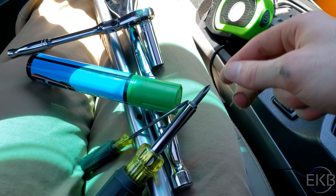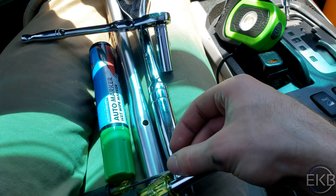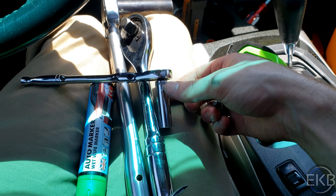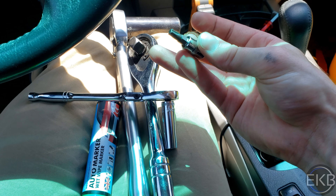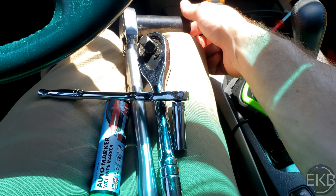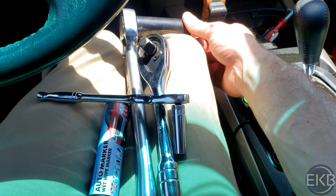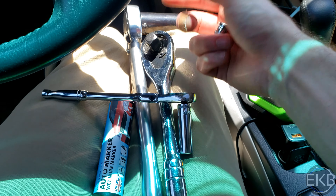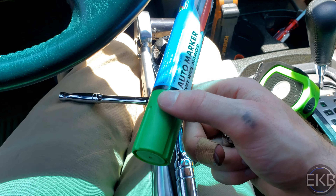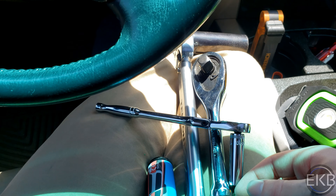The main tools you're going to need are a Phillips head screwdriver, some type of small flat head screwdriver like a prying tool, a 10 millimeter socket for the battery, a T30 socket for some screws, a 19 millimeter socket for the nut holding the steering wheel on, a wrench, a torque wrench, a marker to mark position which you'll see later, and some flashlights wouldn't hurt. That's really everything you need, nothing crazy.